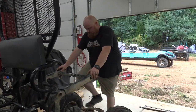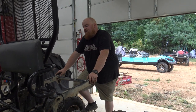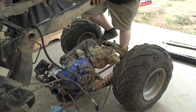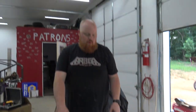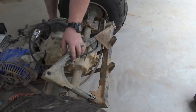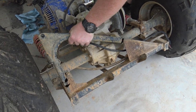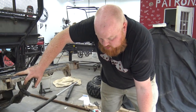Off camera I got a piece of three-eighths round stock and extended my pick and knocked it a few times — she popped out, kind of like a bushing or ball joint. So I'm going to look over the swing arm and probably reuse it to save time. I'll just cut the whole panhard bar setup off, grind it all smooth, and build a new one. This looks like it's 14-gauge, but I always use eighth-inch thick steel on my panhard bars. So I'm going to build a whole new panhard bar and mount the new diff on it.